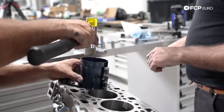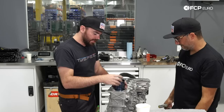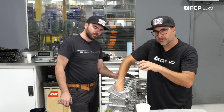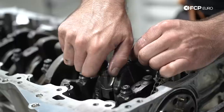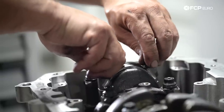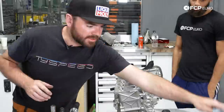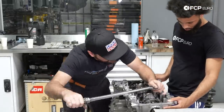The tip with the universal compressor is to go nice and easy, working back and forth left to right — don't keep hitting the same spot or the piston can bind in the tool and break a ring. Any time you feel extra resistance going down, stop, pull it back out, and check it — something's hanging up. We have cylinders one and six installed in the bores now. We'll tighten the rod caps on those two, then rotate the engine to the next pair and repeat. Tyler and Michael install all remaining pistons in pairs, torquing each rod cap to spec as they go.